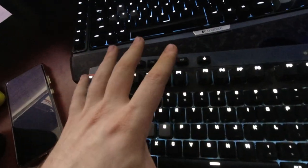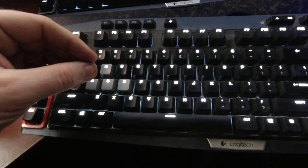But over here where I cleaned, if we look at the comparison over here, it's way brighter. That's the difference of the matte black metal absorbing the light versus the matte white absorbing it and dispersing it through the paint particles. So that was basically what I was trying to get at here, because newer keyboards that have the whole back glow, they actually have a white piece of acrylic, frosted white. So that acts for the light to go through and then light up the whole thing, because it kind of glows through the whole thing.